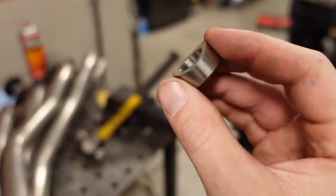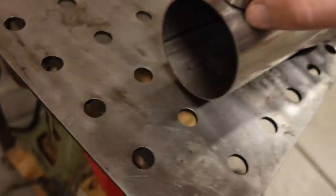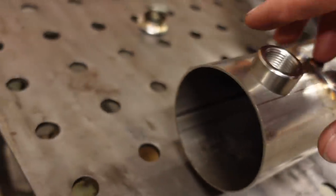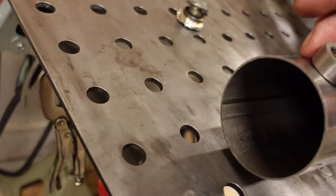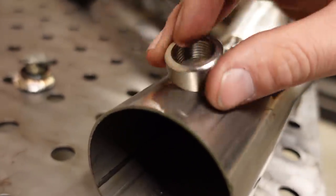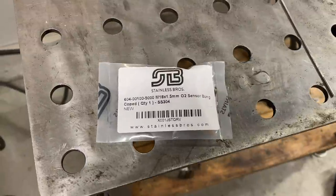This is from Stainless Brothers, I think. It is a coped O2 bung, and it fits perfectly on a 3-inch tube like that. So there's no gaps, where normally if you get one of these that are flat, well, that's kind of how it would sit. And this just makes for a much nicer weld if you have zero gaps all the way around. So those are pretty handy. I'll put a link in the description below.